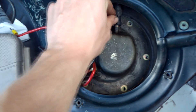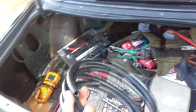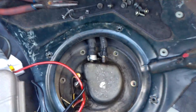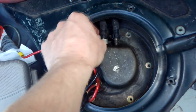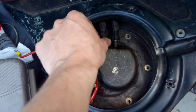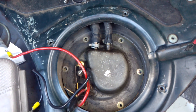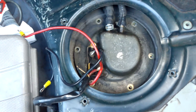Then disconnect the lines. In my case I'm going to be replacing them because they're factory ones that have had a pretty good life. I'm replacing them with Gates Green Shield hose, which is E85, methanol, alcohol, and diesel compatible — really good stuff. I'm replacing every single rubber fuel line and all the O-rings. You don't have to, but they're probably 20 years old or more. It might be 60 bucks to replace everything, but you only do it once.